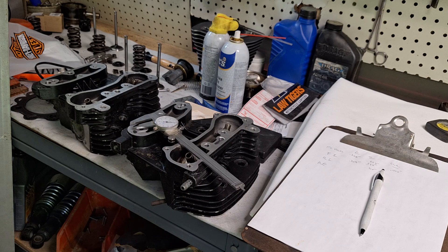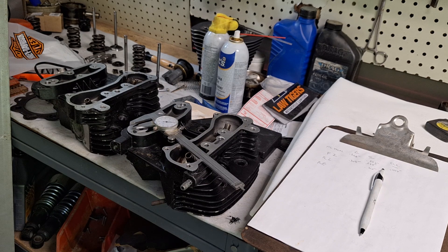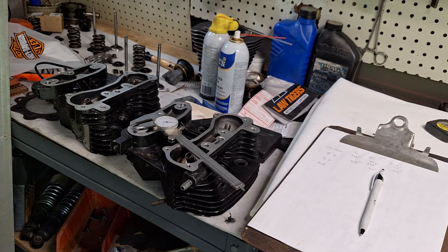I've already cleaned these out, so we're good. Now if you have to replace the guides, it's a fairly straightforward process — you're going to knock the guides out with a drift. There's a special driver made for that. Reinstall the guides as centered as you can get them. You will have to do a valve job afterwards, because no matter how straight you think you're going in, it's going to be crooked a little bit. The valve isn't going to be concentric with the seat anymore.